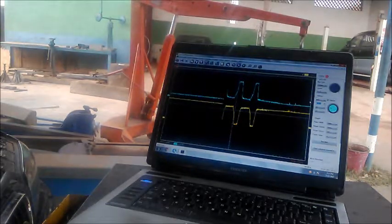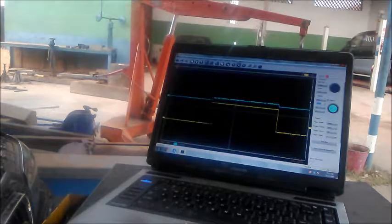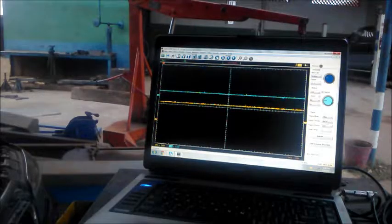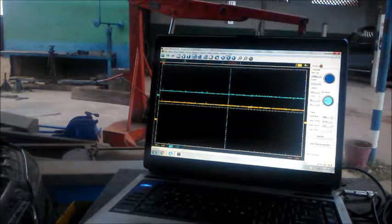Okay, that is for when the motor is working properly. So I'm going to wait for it to cool a bit, because it seems the problem comes back whenever the engine is cold. And then I'll try to do this test again, because that's when this thing doesn't like to accelerate. So I've been able to duplicate the problem. I'm going to step on the accelerator pedal again, and then we shall see what happens to the accelerator pedal position sensor. I've just woken the oscilloscope back up, so let's see what happens.